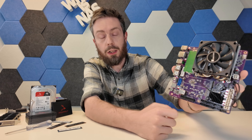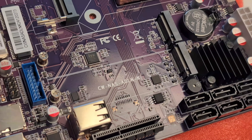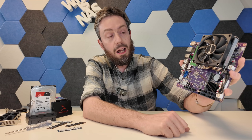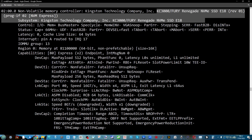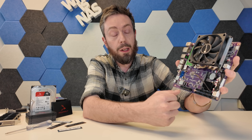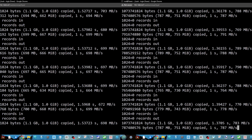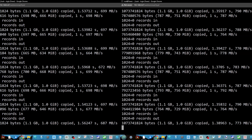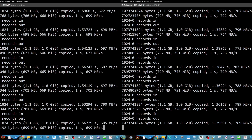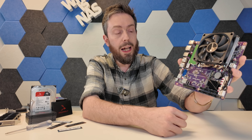Let's talk storage. There are two M.2 NVMe slots — nothing on the rear of the board, it's completely blank. I dug into terminal and found that both M.2 slots are running at Gen 3x1, so you're looking at around 880 MB/s potential throughput. In repeated 1-gigabyte file testing, both drives gave us around 780–790 MB/s read and 690–700 MB/s write — not complete saturation, but this is a very power-efficient CPU.